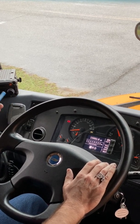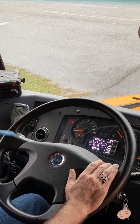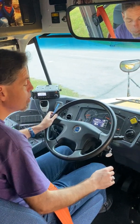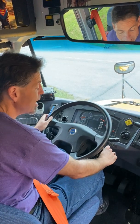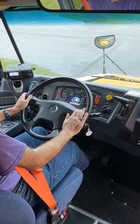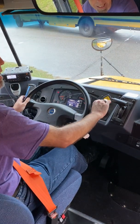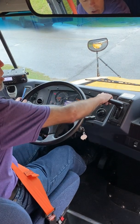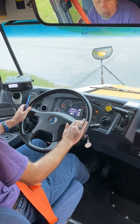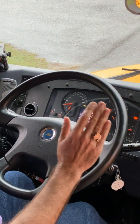Now I deal with the early test portion of my test. I do four things: I turn off the engine, then I turn on the accessories, then I apply my service brake and hold it. Then I push this yellow diamond-shaped knob to release my parking brake — it controls my parking brake — just like this.